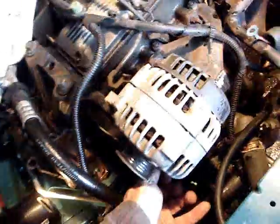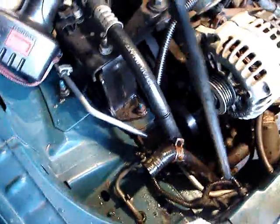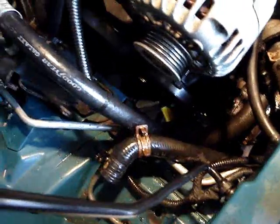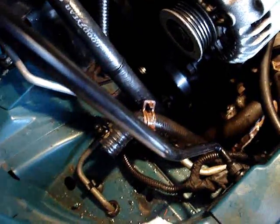Alright, discovering this, I'm suggesting you pull off the alternator for sure. Whoever designed this got this air conditioner hose crapping away. Anybody who designed something like this, and this is old stuff, never intended anybody to ever fix anything. Whoever that is, I'd like to meet him. I think there's a lot of other mechanics out there who will say that, but anyway, I'm suggesting you take off your alternator and pull all your hoses off.